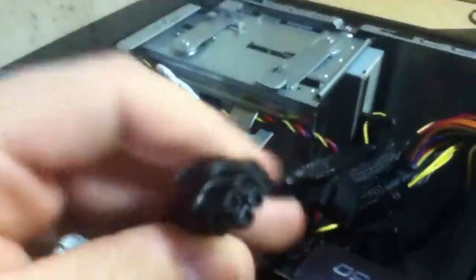I've got my 400 watt power supply and my graphics card — I know it gets kind of crowded. Take your 6-pin PCI Express connector and just hook that in and make it snap. And that's about it.